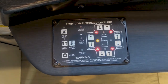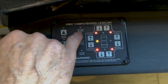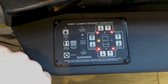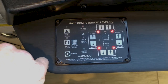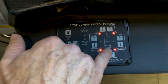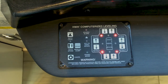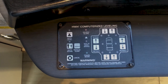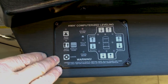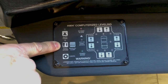If the area has too much of a slope, the excess slope light will come on and you'd need to move the coach to a more level position. If at any time you want the jacks to store and go back up, just hit auto store. Once all jacks are down and the yellow lights are off, the coach is level and you can turn off the ignition. The warning signal you heard was because the ignition was on while the air wasn't in the airbags during leveling.